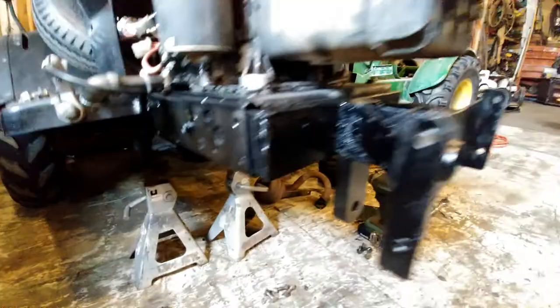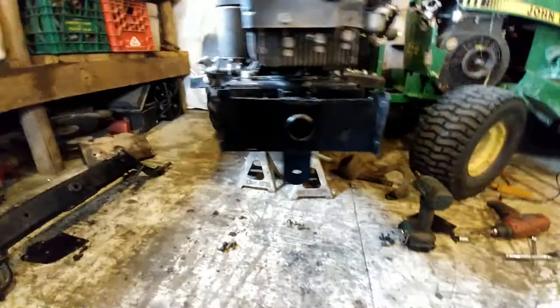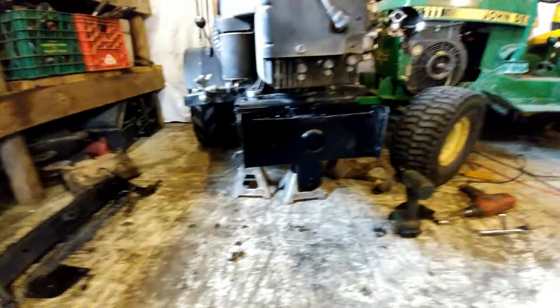So this setup is way stronger. It slides right up in on the inside of the tunnel, so I gain a couple inches there in the long run. I'm going to bolt that up and put in the new steering bar, the new steering system. The bolt to hold it in is a five-eighths, five and a half inch — I gotta get a new one because this one's only four inches and it doesn't go all the way. Then I hook up the steering linkage. And this is my front bumper — I'm putting it back, so I had to get started.